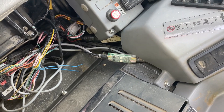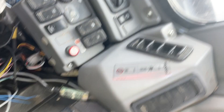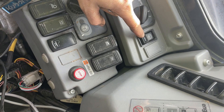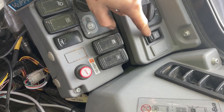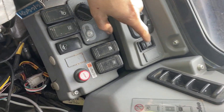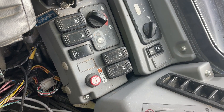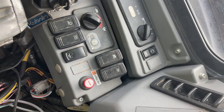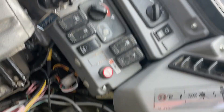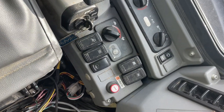That button will just act as a momentary switch. They also offer non-momentary buttons for things that are on/off. One thing I'd like to wire — which I'm not going to get to today — is wipers. Wipers are non-momentary, so I'll need a different button from Ncon. In the meantime I might wire them so I have to hold down the button, since a momentary switch works as continuous so long as you hold it, which would give me one swipe rather than continuous.